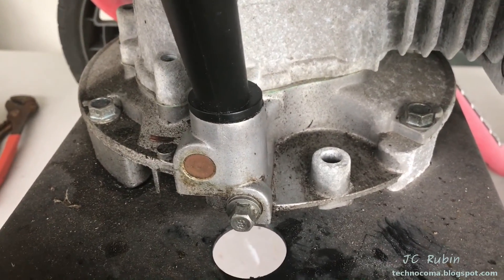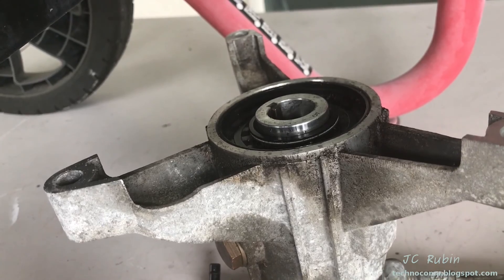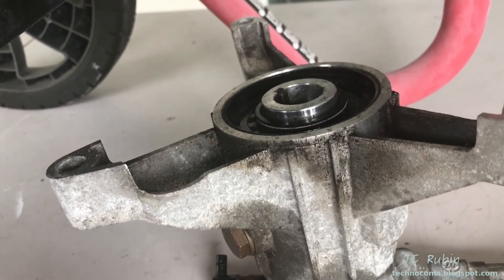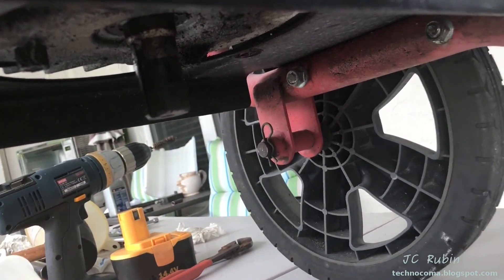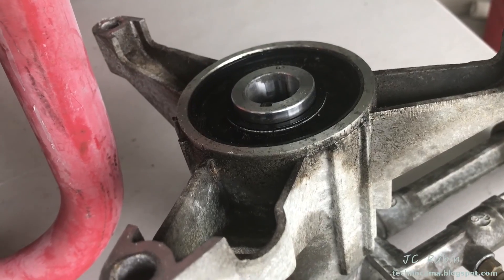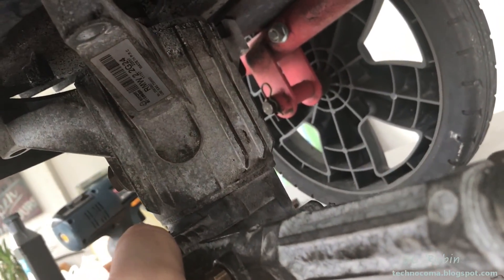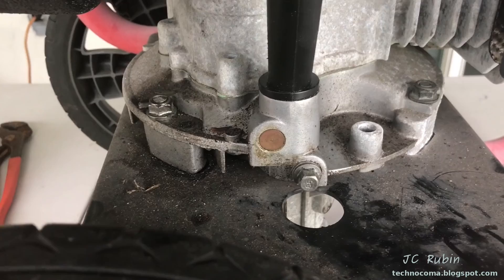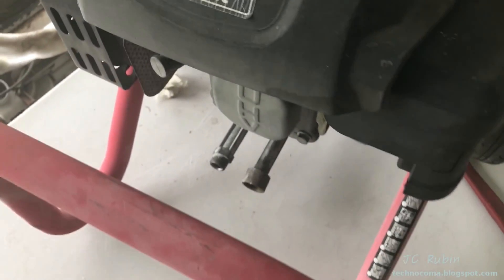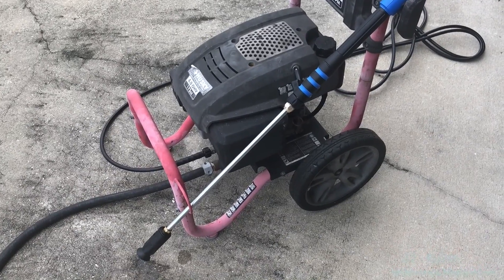I'm going to remove the two bolts I ran through to secure the engine into this chassis. The pump has rotated with the work, so it's important to line that key up with the detent on the shaft of the engine — we can see that's pointed outward towards me. So the pump is going to have to be turned by hand. I put a towel in there and rotate it a bit. I've got it at a decent approximation now. Once I slide it up and it's fully seated, I'll run the first screw up to hold everything in place so it doesn't fall back down. All three bolts are in, just tightening them down now. Last order of business — we're going to give it a light pull with the pull start, make sure nothing's binding. Seems okay, hook up our cables and give it a shot.